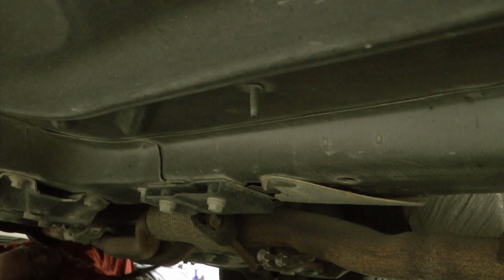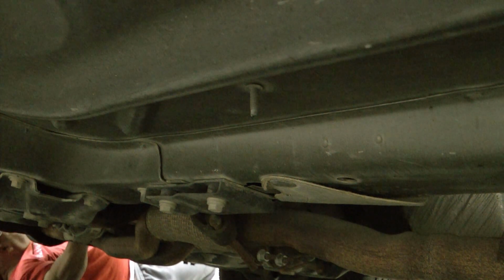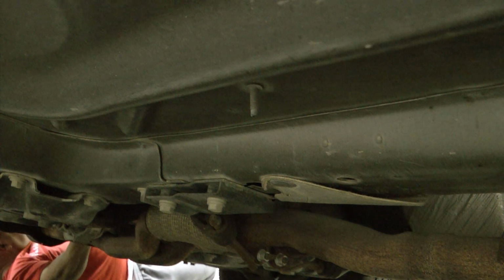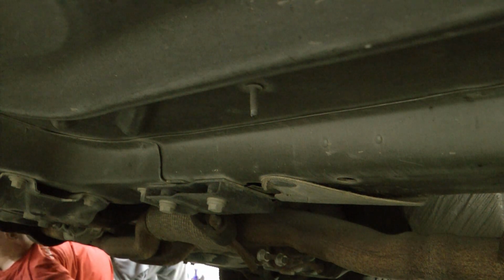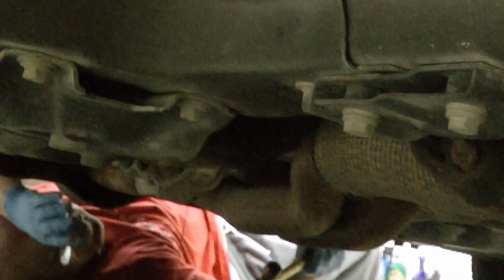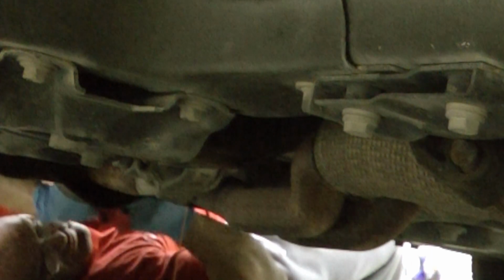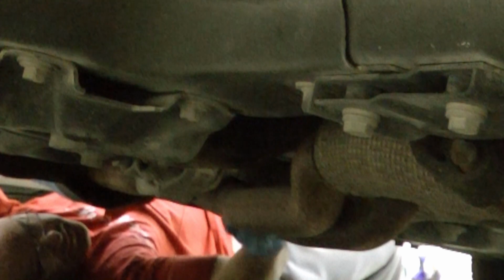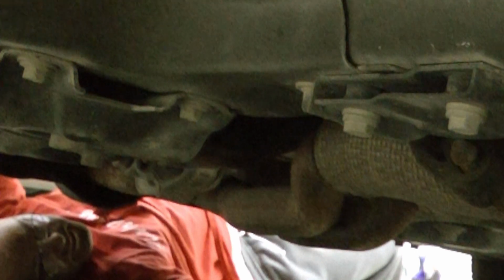There's 20. Just like there's no reason to over torque these oil filters. It's hand tight, plus no more than about a half a turn. That's one way to make this a little bit less messy, is pulling the oil filter outside of the metal. And hopefully it won't look like now it's going to drain into there and start spilling all over the place.